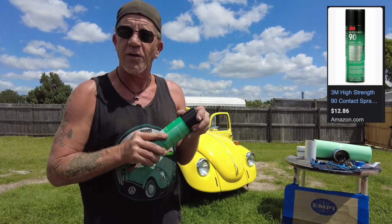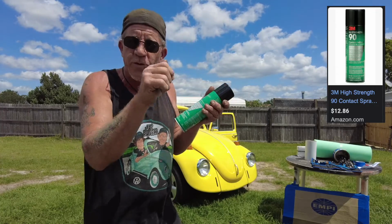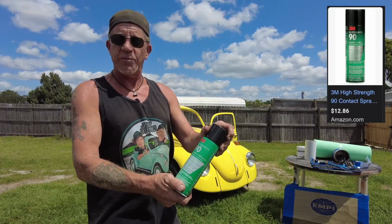Just wait for it to dry a little bit, a little on the headliner material, a little bit on the surface. Wait about 5 minutes. You can't wait really too long, it's going to move. You can put it down and I don't like that, and you can peel it back off and it's still going to make contact and hold. So don't use anything else but this.